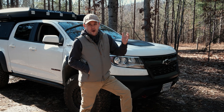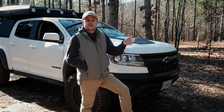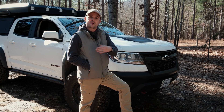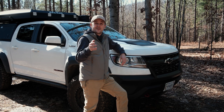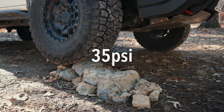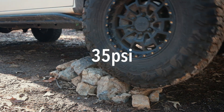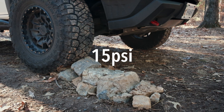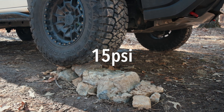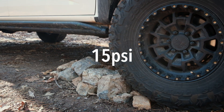On that trail there were no really rocky sections — just a few rocks here and there. So we've decided we're going to build a small test course. We're going to roll over a pile of rocks at the same three different tire pressures so you can see how it affects the tire's footprint, the flex of the sidewall, and all of that. That showed it a little bit better, but it's still not super obvious how much flex you get between the three different PSIs. One of the factors for that is it's a mid-size truck on six-ply tires, so we decided what we needed was a bigger truck.